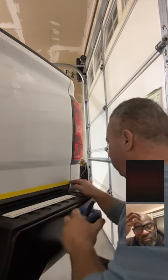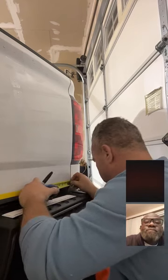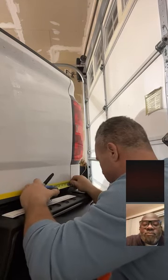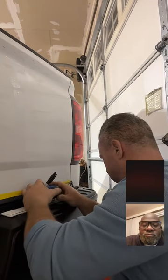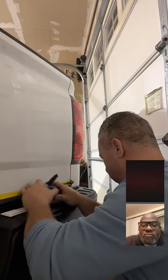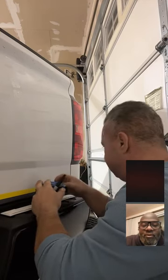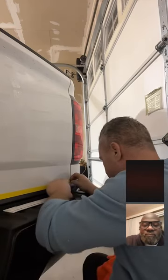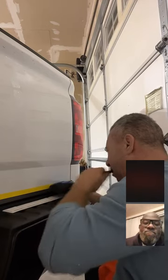And that is the reason why today's clears are so thin. People don't understand, the manufacturers would want to put twice the clear that they do. They can't, because when you put that much hardness into a clear coat, you have to put it on thin or it will crack. Not like lacquer. Honda figured this out.